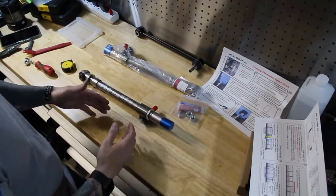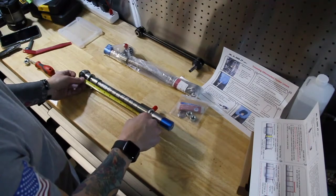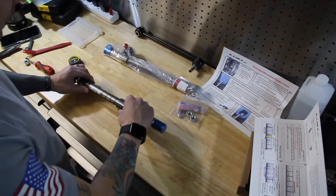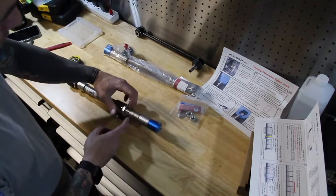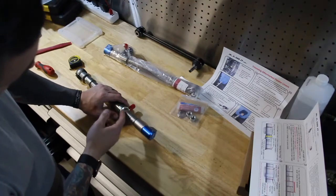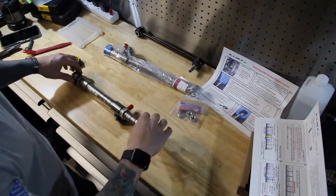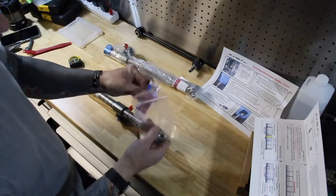So this AutoLynx comes shipped at what looks like a 9-inch. So it's 9-inch from center hole to the locking ring or the snap ring. And what we're going to do is slide this cylinder down over this snap ring. And then we're going to remove this nut, unscrew it, blue Loctite it, bring down this snap ring all the way to this point right here. As you can see, there's a point right above this nut, and we're going to lock it all the way down onto there, and then that'll lock these two points together, and then when you disconnect, it'll extend within this housing here. Obviously, Apex gives you blue Loctite.